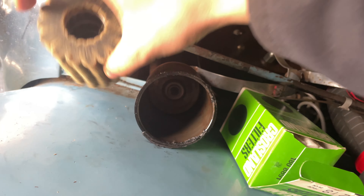With the petrol line completely in, it's time to think about putting the refurbished tank back in. There are two main things to worry about. Firstly, I need to make sure the wires for the tank sender are on top of the tank when we bolt it in, otherwise I won't be able to reconnect them to get the sender to work. The other thing is the filler neck, which makes it rather more difficult — you have to try and tuck the tank up inside the car to get the filler neck aligned before you can sit the rest of the tank in the bay. I'll inspect the area and give it a bit of a brush down first.